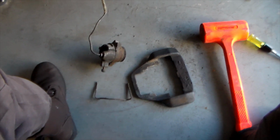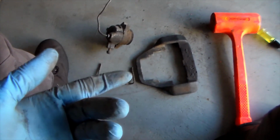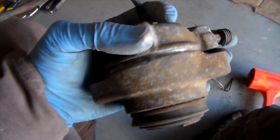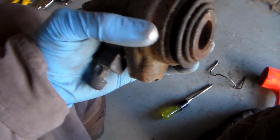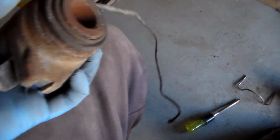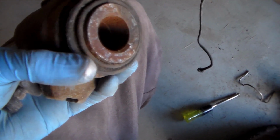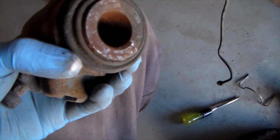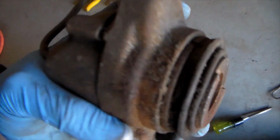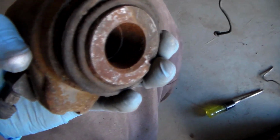Alright, so we're back. The other stuff is actually cleaned off. I'm spray painting them now, they're drying. And then this part, I came back to it, got it taken apart. So coming back here to the cylinder housing, this thing is pretty rusty. There was a little bit of black soot on the calipers whenever I was cleaning them. I'm pretty sure the story behind that is that these boots right here got really old. They seem very, very brittle, and some of them were actually split and cracked up front. I'm pretty sure they're the original boots on them, so they're probably like 40 years old.